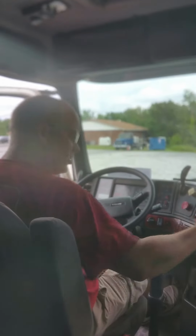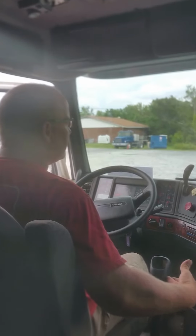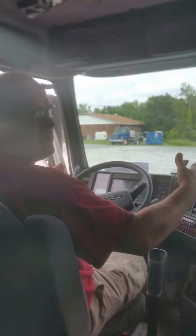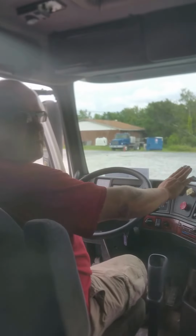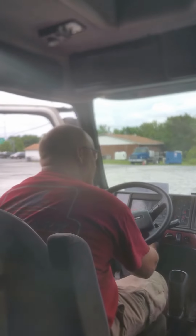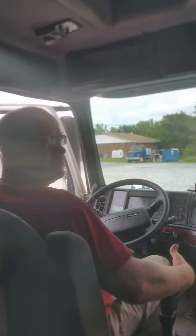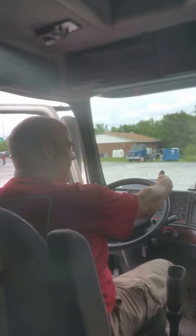All you're going to do here is leave the truck in first gear just like we had it. We're going to roll forward, put on the brake, make sure the truck stops, make sure it doesn't pull left or right, make sure you don't hear any unusual noises, okay? So both my buttons are already in, right? Truck's already in gear, right? All I've got to do now is shut the truck off, release the clutch, and now I'm secured in first gear on flat level ground. Turn my switch back on till my fan comes on, make sure I've got power to the dash.